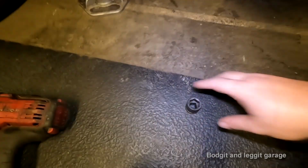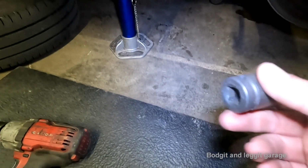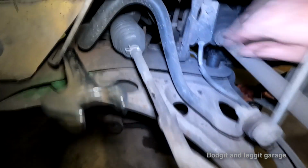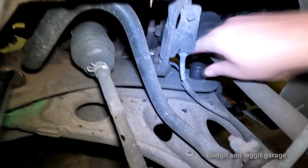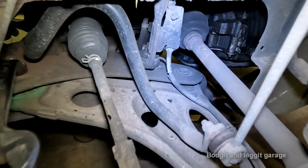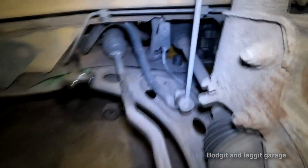Yeah. Right, and what I'm actually using to also help with how high the vehicle is off the ground, I do have a smaller gun, a 3/8 gun, which is very powerful, but still not as powerful as that. So I'm using shallow sockets, which helps, but you need a 21mm shallow socket for this regardless. Because of this bolt here, it's just easier to get something on there. Because of how thin the head of that bolt is, when you put a spanner on it and try to undo it and tighten it, the spanner tends to slip off, and it doesn't take much to round that off and put you in a lot of trouble. And you can't really use a normal size socket because you won't be able to get it in. So the short reach or shallow sockets really do help you on this job.